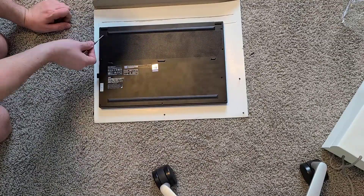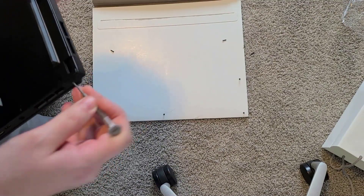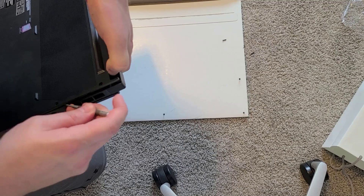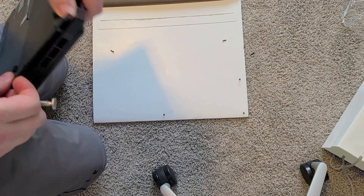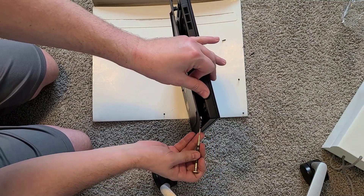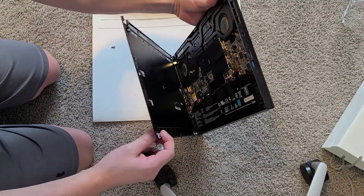In this instance, most of them are all the same length, so it won't matter except for the front piece. I take it apart and switch to a flathead, and I gently prop the underside of the back plane so as not to leave any visible scratches, and just carefully prop the back plane open — extremely slowly, putting almost no pressure — as I literally just pull the screwdriver downward, not out. Careful not to bend the back plane, which is extremely fragile aluminum.